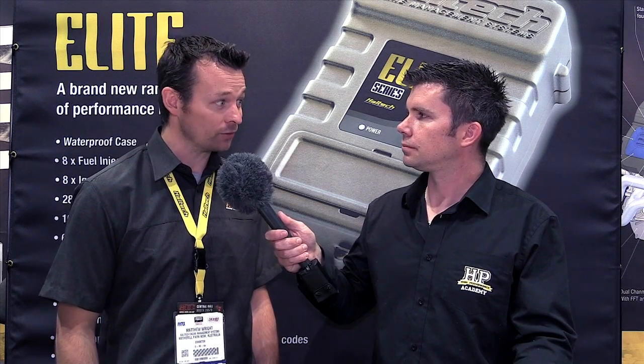The new case is a complete change from your existing extruded aluminium cases. Why did you decide waterproofing was a requirement? There are a number of reasons. Things like jet skis and boats are all fuel injected these days and there's a lot of modifying happening there. If you're going to put the time and effort into producing a waterproof case, why not make it waterproof for everybody? Also, a lot more ECUs are getting mounted in the engine bay — off-road vehicles, rally and road vehicles. When you wash them down you just get out the power washer. Going waterproof doesn't limit people who want to mount it in the passenger compartment, but for those who want to mount it outdoors, they can.